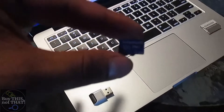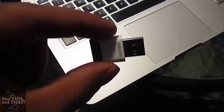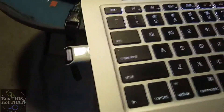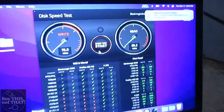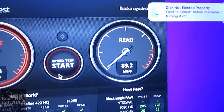Now we're testing the more pricey Samsung 128GB Pro Plus — the one that comes with its own adapter. Let's see if paying more gives better results. Wow — 119 MB/s write speed and 153 MB/s read speed using the Samsung adapter. We then tried it with our standard card reader, and here's the difference on the same card: 80 MB/s write speed and 89 MB/s read speed. That is a big difference.